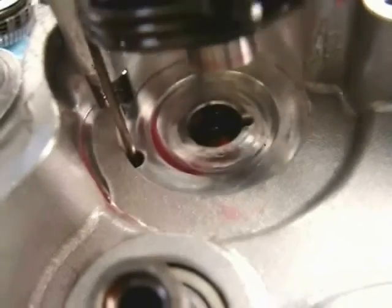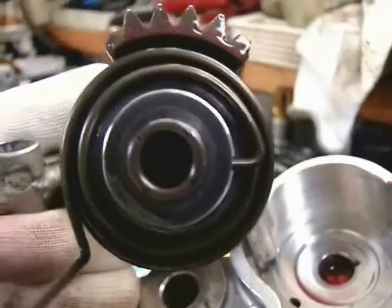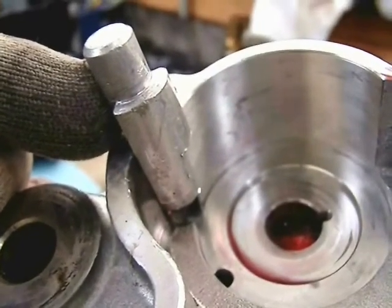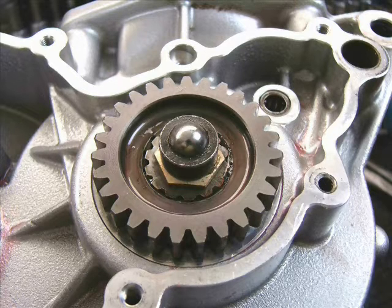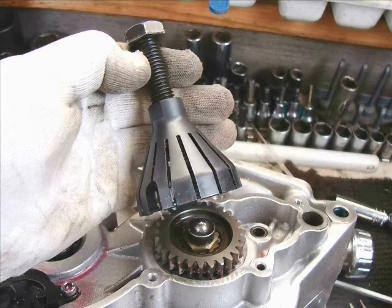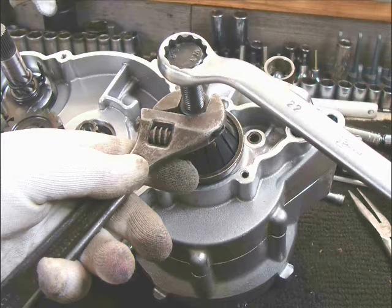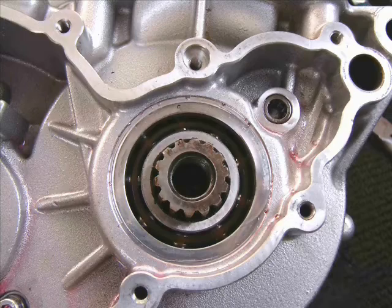There you can see the kick start spring goes in a little hole in the cases. There's a washer on the end of the kick start shaft assembly. You can see some residual oil down where the kick start pivots and a little feed hole on the side. Now we already had that bolt loose on the primary driven gear, so I'm going to use a little protector bushing so my puller tool doesn't harm the end of the crank. There's a special tool — you put it over the gear, press a compression ring down over the tool, and that makes the tool grip the gear. Then two wrenches remove it. The gear is interference fit but semi-mild. There it is removed from the right side of the crank — you can see the crank bearing right in there.